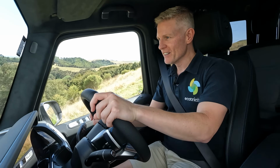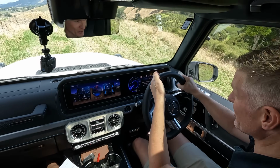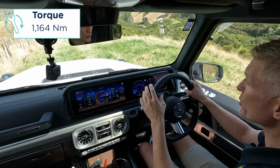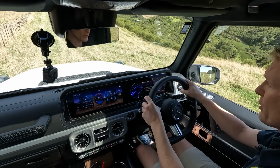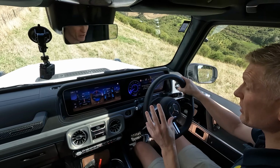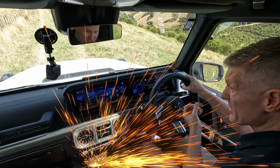All right, you join me in the G580. We start off-roading. That is an unusual way to start a video review of a car, but let's start with tech specs before we get to the off-road segment coming up. So we have 432 kilowatts with more than 1,100 Newton meters between all four wheels. Yes, of course, it's all-wheel drive, but it does one better. This is the first off-road vehicle I've ever been in that has an individual electric motor on each wheel, and it's got a low-range gearbox, a reduction box on each wheel as well. That's crazy. It means that 1,162 Newton meters of torque should be dropped viciously to each wheel.